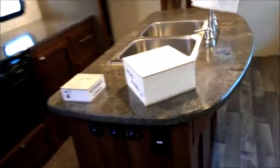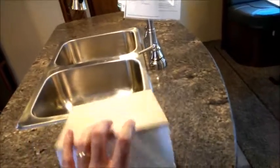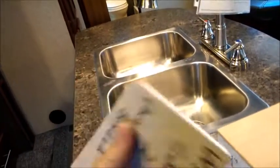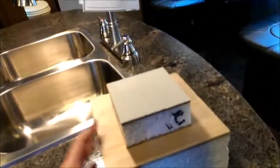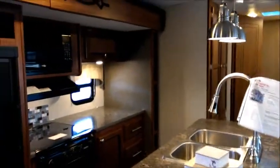Here are some cutaway samples — look how thick the roof is. That's a four inch thick vacuum bonded roof with aluminum framing. You can't compress it at all by hand — super dense, super strong, yet lightweight. The two inch thick sidewall is the same — very dense, very lightweight with the fiberglass exterior. The floor is similar, not quite as thick, but very dense aluminum frame vacuum bonded foam. A lot of construction upgrades make this unit very strong yet very light.